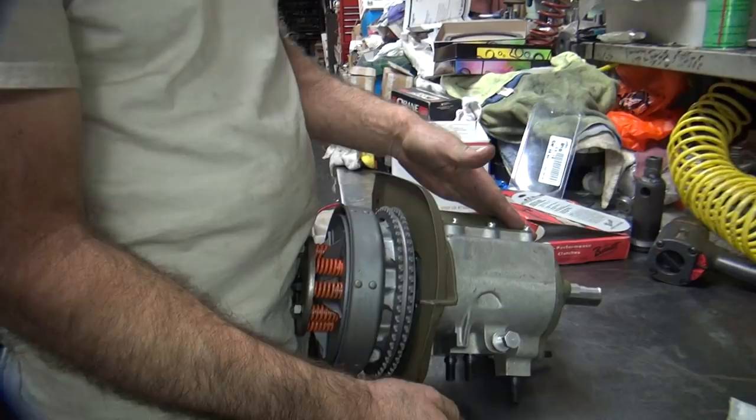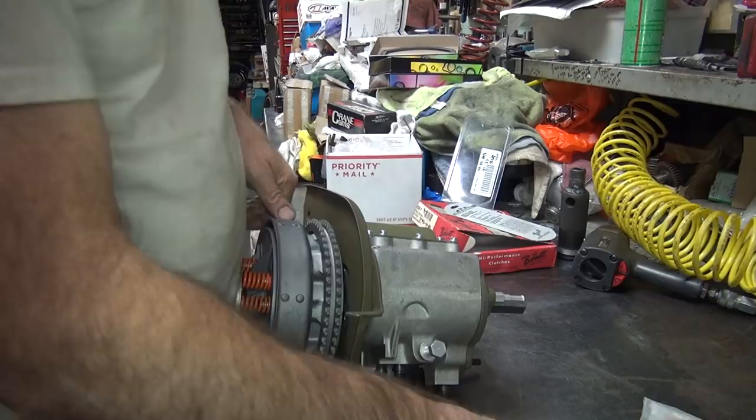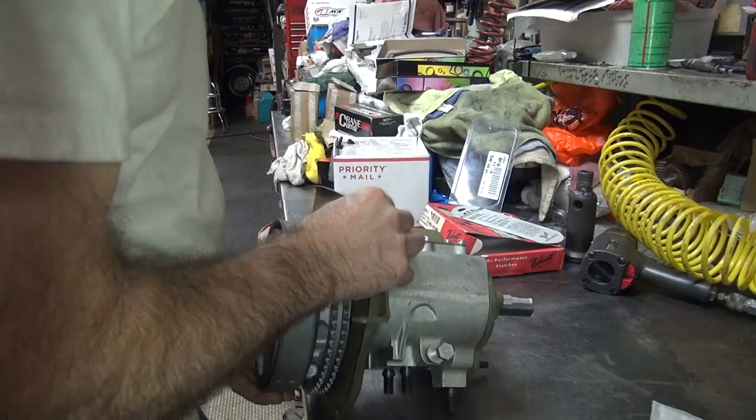And there's no tensioner on the primary chain. No. What's the tension on the primary chain? You want 3/8 to 1/2 inch of free play at the tight spot. 3/8 to 1/2 inch, okay. And that's not yanking on it, it's just going up on it with the finger lightly. It's like using a pencil type pressure, or a pin. A lot of that's just common sense.